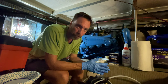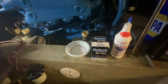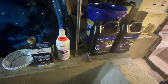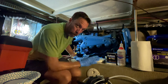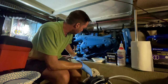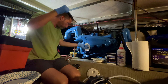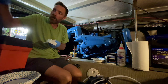We've gotten everything to temperature. So we have all of our accoutrements — we have a paper bowl, which I'll show you why in a moment. We have our oil filter. I'm going to put a little stabilizer in there as well. New oil — these Crusaders ask for a straight 40-weight, no blends or anything, just straight 40-weight oil. First thing we do is take a paper towel and pull out the dipstick, get that nice and clean, and set it aside.